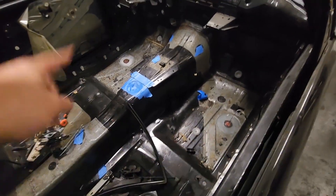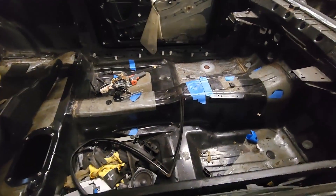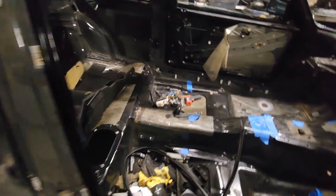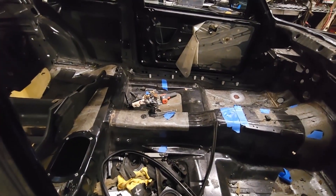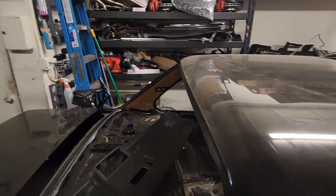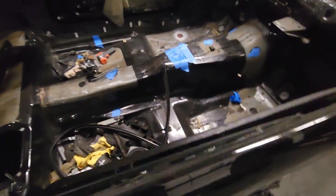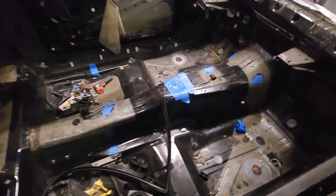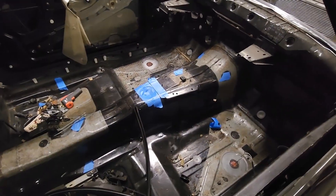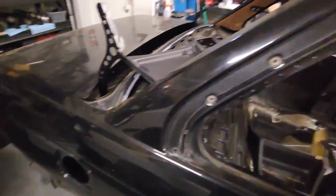The previous owner jacked up the car by the drains right there, so I went and knocked them down and put some primer on. All of the sound deadening material has been removed from the whole car — I'm going to put fresh material in. I'm going to go with Vibro. I'm going to have the chassis painted and probably just have them paint the floor so that I can get all the glue off before I lay the new mat down.